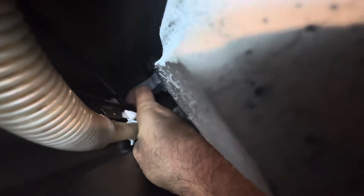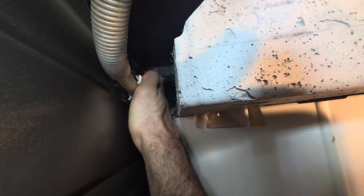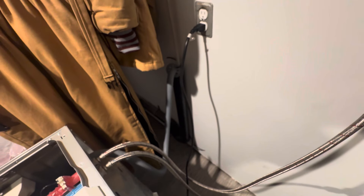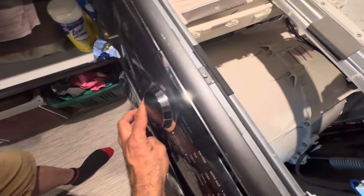This unlocks the door. Anytime it's not unlocking itself, you can just press on this button and then the door opens. After the door opens, unplug it and plug it back in. Then do the same thing — whether the door opens or not, keep pressing on that button and releasing it, doing that until it opens completely. If you have water inside the washer it may not work — you want to empty the water by vacuuming from the drain hose at the back, and then keep doing the same thing a couple of times.